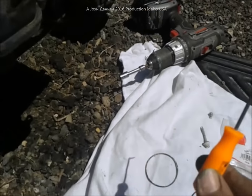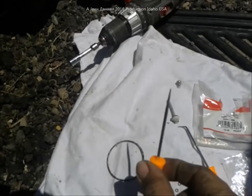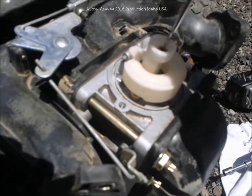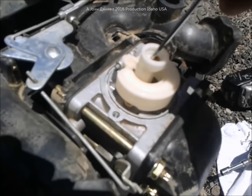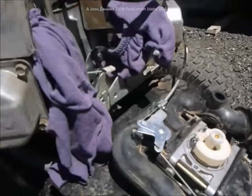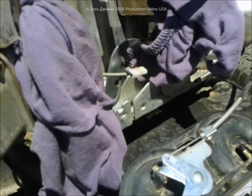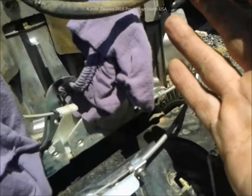Now what we've got to do is use some very fine point tools to work on these jets. I'm going to pull the jets out one at a time. Look at this — they just slop around in there. That O-ring is supposed to hold these in there, and that jet is loose. This one's still tight, but this side is very loose. I can do this overhaul of the O-ring set by simply taking the governor arm loose. You'll see the governor arm right here — if you spin the carburetor that way as you pull it off.